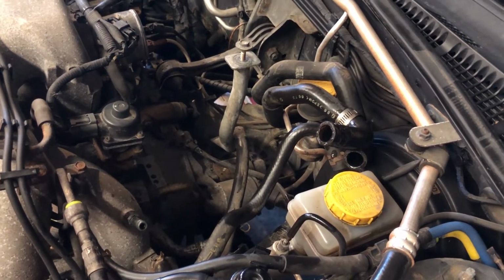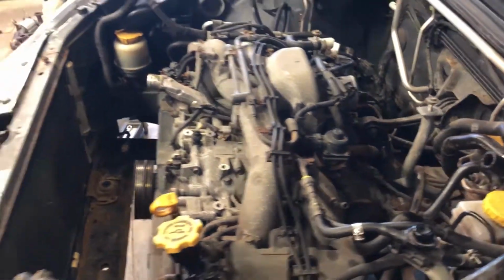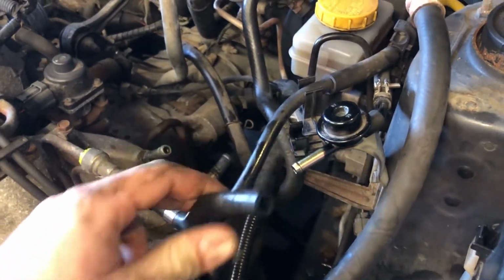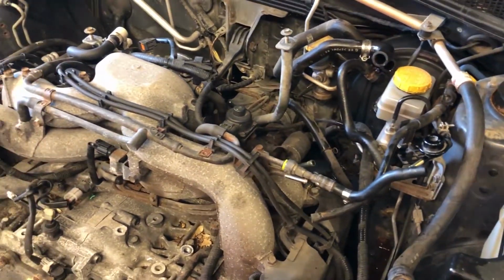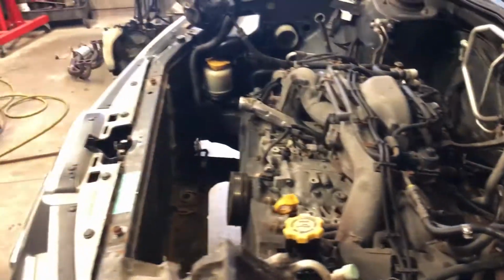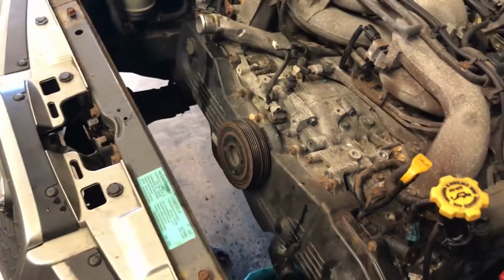I doubt you can see any of it. I finally got done struggling with these heater lines that go to the back of the engine for coolant. Instead of trying to use the quick disconnect, what we did is take the fuel line off farther down the line at the pressure regulator, which doesn't really matter anyway because we're still going to be using this intake on the new engine, so it can just drop back into place and we can reattach these lines later. The radiator is also removed and you can see there's tons of room for activities up front here.